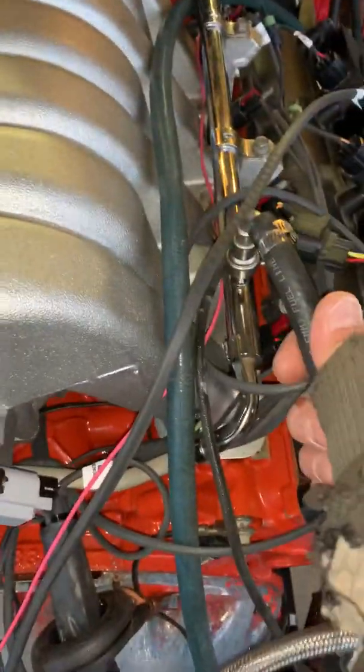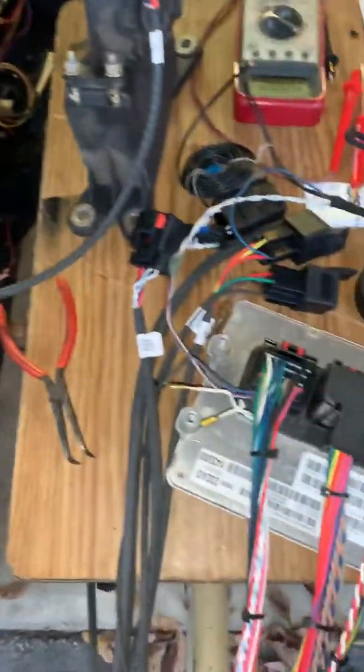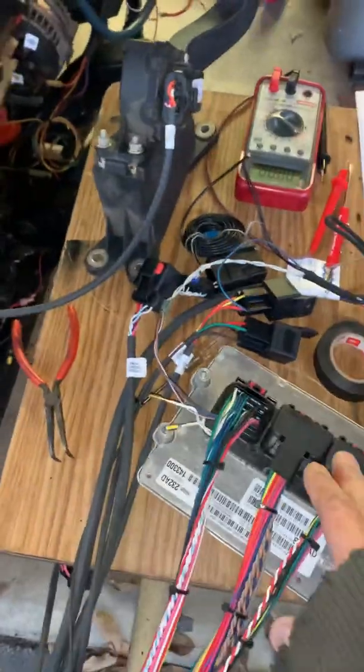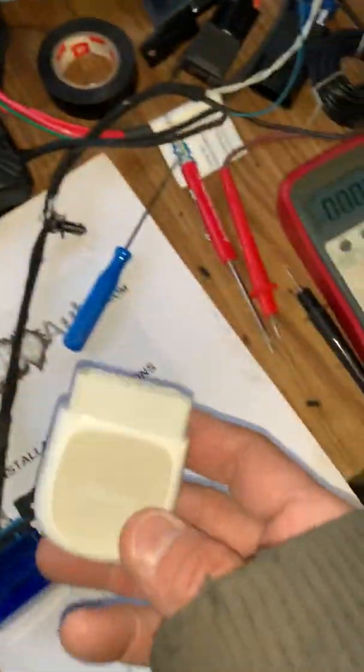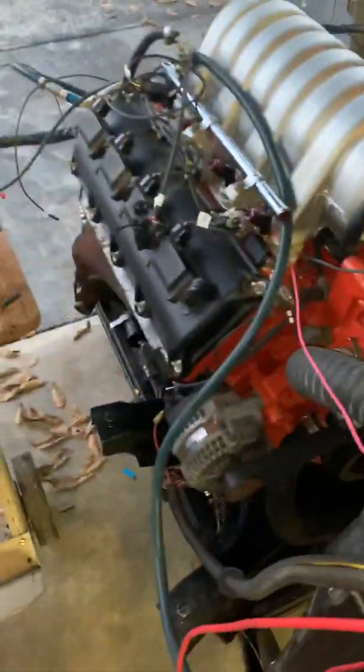This is the drive-by-wire throttle body — the other one I had on here was the one I modified. I'm going to change the fuel rails to put my return system on it because right now this is just a deadhead system. This is a brand new Hotwire harness I bought off a guy on Facebook Marketplace — he was into the G3 swap and had this 6.1 computer tuned by a Hemi tuner. It fires right up and I'm able to read the VIN and calibrate the gas pedal with my Autel reader. This reader lets me go in and change all the settings. Good luck with your swaps, guys!